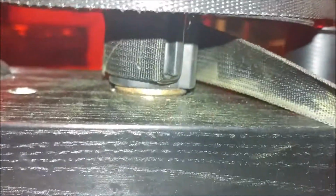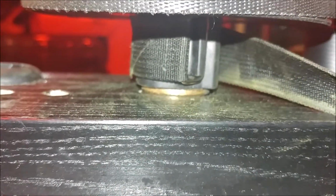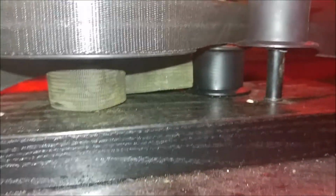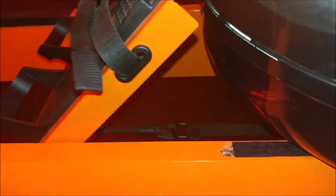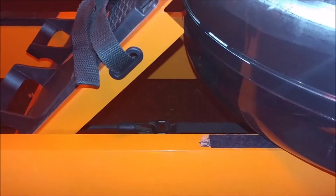and leave that there. Now, with the bottom strapped on, I'm going to give it one complete turn around the pulley and then feed it around and down to connect to the bungee cord. Make sure you got it right. If you pull the strap and put it to where it sits, the cup link between the bungee cord and the strap should sit just between the tank and the frame.